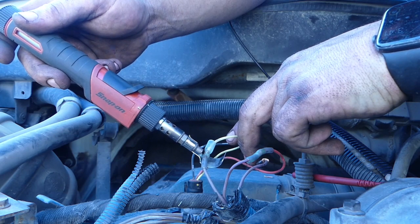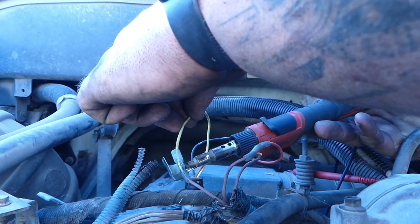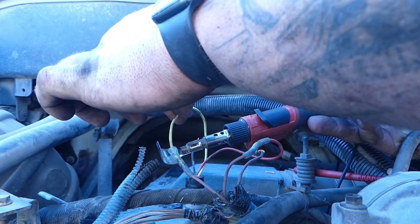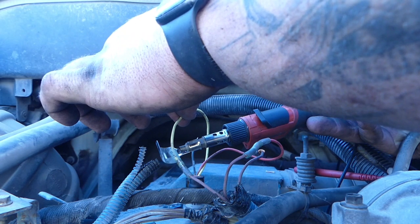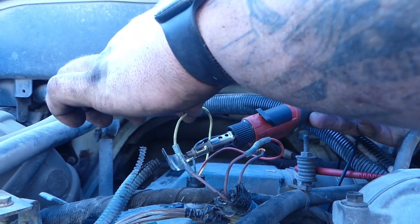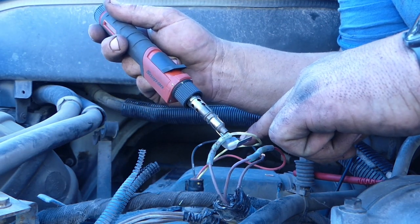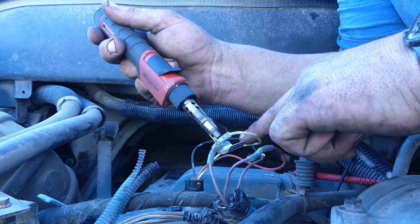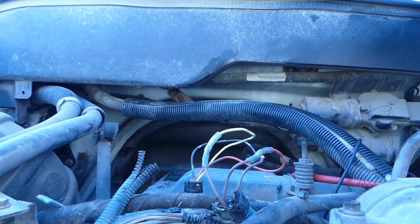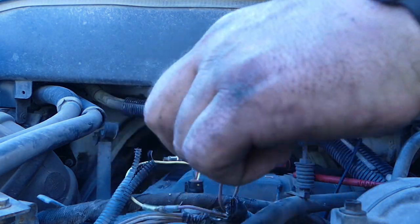But here you can see how it goes clear on these connectors, these solder joints. I like it. It makes it a good solid joint for the rust and corrosion we have here in Michigan. I think it's just as good as heat shrink and anything else because you have your solder joint inside already. I don't want to poke anything on a harness at all, right? So it just makes it way nicer. One solid band of solder, and it works really well.